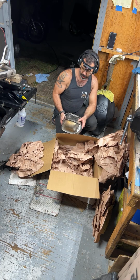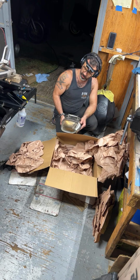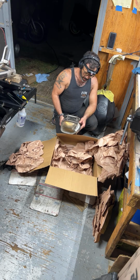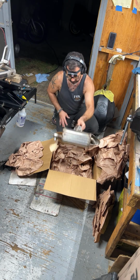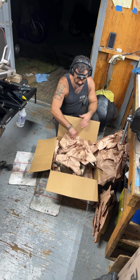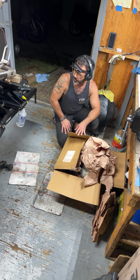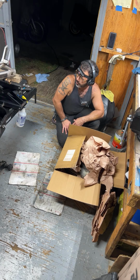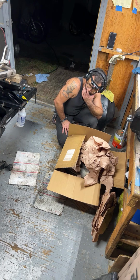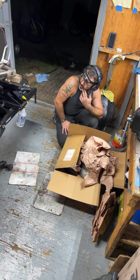Overall, if the customer wants to keep the bike and not have any issues with burning up the valves and having loss of compression over time, it's usually better to run the stock exhaust system. But yeah, I think that's it for right now. I'm going to throw the phone on the charger, take a quick break, and then we're going to come back, finish cleaning up the bike there, and put on that exhaust system, mock up the front sprocket, maybe mock up the chain.